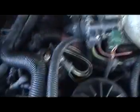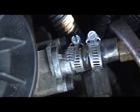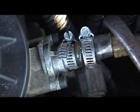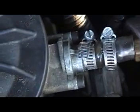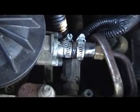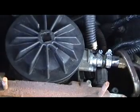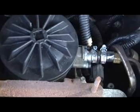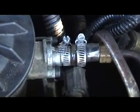The other thing, if you're having a problem getting air in your system, here's a neat little trick. Go up to Lowe's or Home Depot and get some clear line, and connect the two with some connectors, from your fuel line to the bowl where your filter is at. Now when your truck's running, if it's full of air, you know you got a problem with a line coming back, which these trucks are known for having a break in the back by the gas tank. Like quarter tank down, eighth tank down, you'll start sucking air instead of diesel. So that's a good way to tell right there.